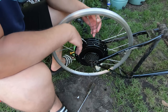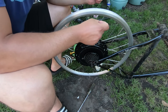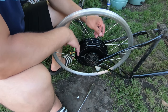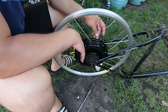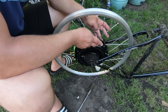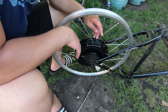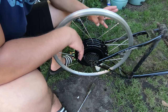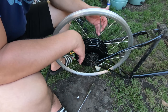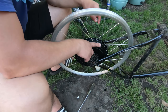I'm at the third set now, but unfortunately the camera wasn't recording. Another thing I want to mention is it's better, even if you do like me, to do the spokes from the same flange first, but put the inbound spokes from the other flange as well inside, because now it's difficult and I don't want to undo all the outbound spokes from this flange to do the inbound on this one.